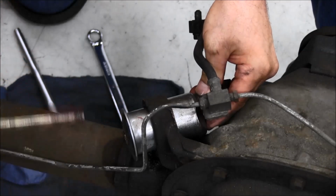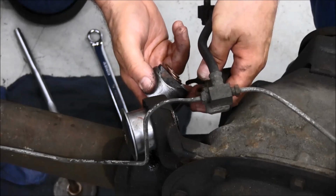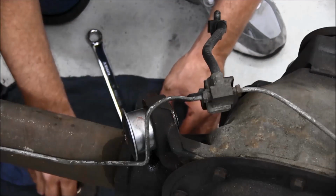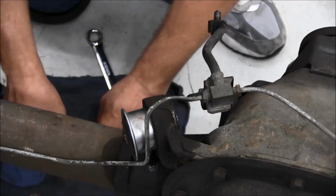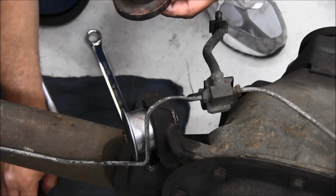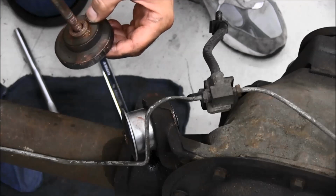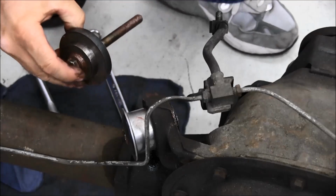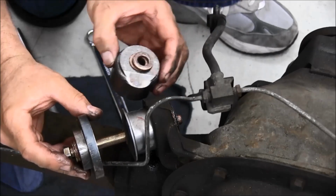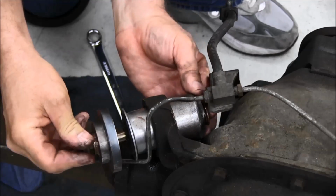Remove the bolt and large flat disc. Remove the nut, washers, and installation cup. Place the small flat disc on the large flat disc, followed by the 3 washers, and then insert the bolt through them all. Put the bolt with the discs and washers back through the bushing, and put the installation cup, washers, and the nut back into place on the bolt.